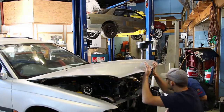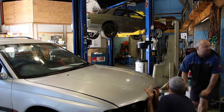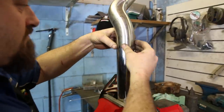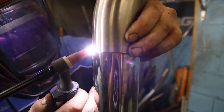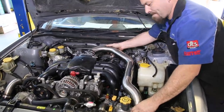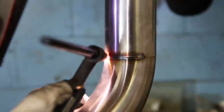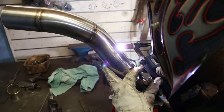We're checking for bonnet clearance and are pleasantly surprised - we'll only have to change the bonnet because someone bent this one in the car's previous life. Turbo Yoda fusion welds the stainless with the lowest possible amperage to keep the weld neat and tidy. Overheating the pipe causes wide discolouration which doesn't look great.